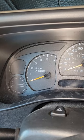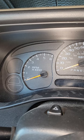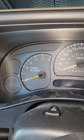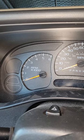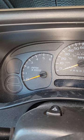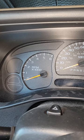The process I'm speaking of today also pertains to different year, make, and models of Chevy Silverados. You'll have to verify that for yourself, as some speed sensors are located on the transmission like today's vehicle, and some speed sensors are located on the transfer case.